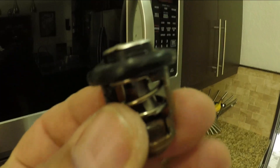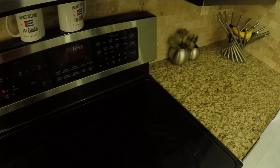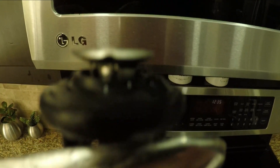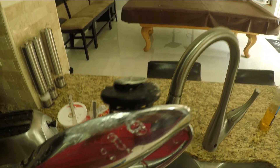Now we're going to test it. As you can see, it's closed up. We're heating up some water in a pot on the stove. This little silver cap that you see right above the black washer — that should pop up when the water gets hot. So we're dropping it into the pot of water and heating it up. Pull it out and look — you can see how it popped up, how it elevated like an elevator. That little silver cap means the thermostat is opening. When the water gets cool, that little cap will go down and close the thermostat. And there — the silver cap went down, closing the thermostat. This is how a thermostat works.